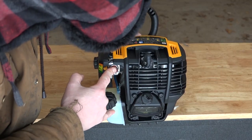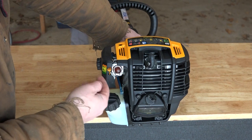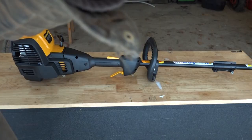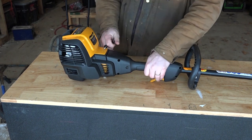You can prime all day long — it's not going to flood anything. What it does is, when you first pump and there's nothing in there, it's pressurizing the gas tank, which forces gas up into the carburetor, goes through all the systems, and then goes back into the tank. We're good — full choke. Should start. Let's see if it'll start, brand new out of the box. About 10 minutes later — let's see. Ready, Thomas? Yeah.